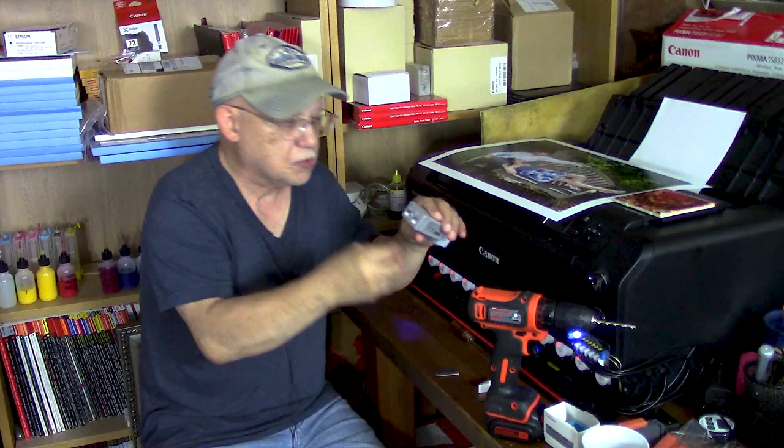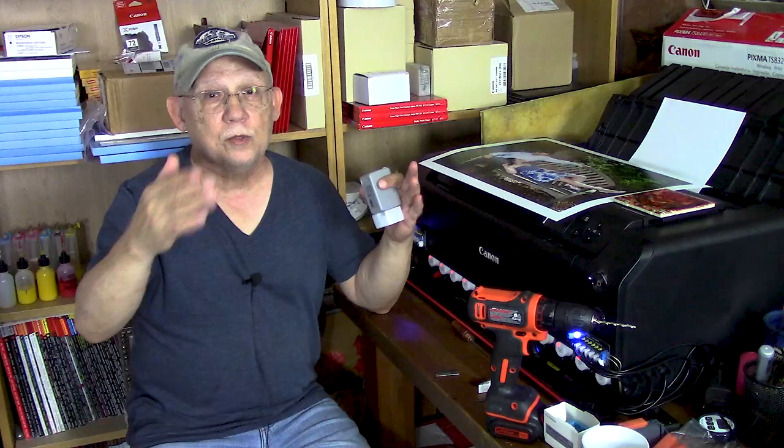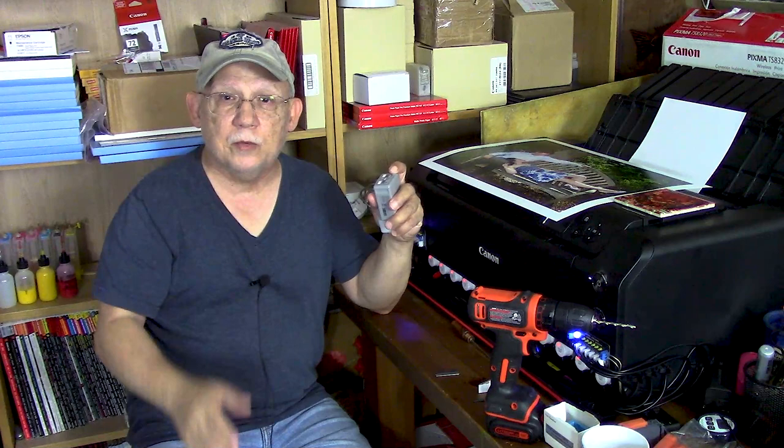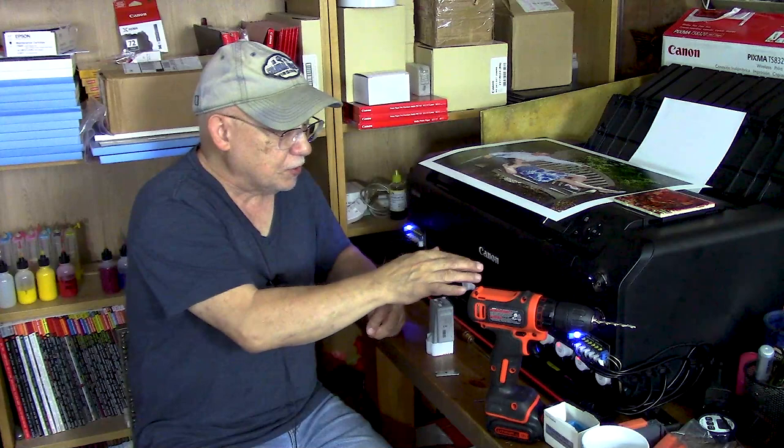Remember, the plugs can be obtained from Precisioncolors or Rick Johnson. Precisioncolors site is a little bit more difficult to navigate. So what you do is this, you go to the Pro-100 tab and then accessories or parts, I believe the tab is, and there you will find the plugs or just buy them directly from Rick Johnson. That is it. You can pop that in after you top it off with 80 ml of ink and proceed to print. Even if you have not installed the ink level sensor system yet, okay?